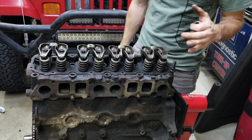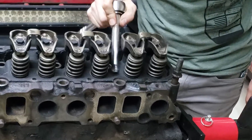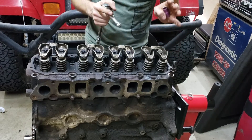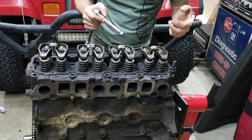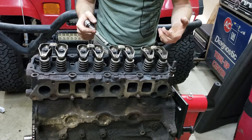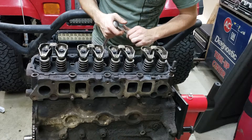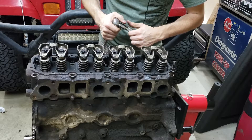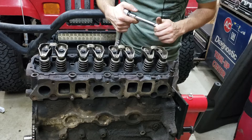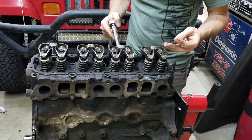The first thing you're going to notice as we tear apart this engine is this down here — you see how this is black? I'm actually knocking a hefty amount of carbon off of here. This entire engine is completely coated in carbon, and I believe that has something to do with the interval between oil changes as well as overheating. The oil just baked right into the steel. This engine had been overheated an aggressive amount of times — when I first bought it, I had no idea what temperature it should run at and I let it overheat every single day because the thermostat had broken closed, so I had no cooling for who knows how long.